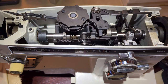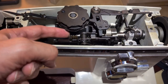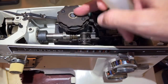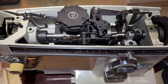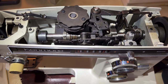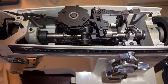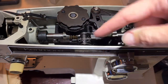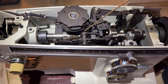Don't add six or eight drops because you're going to flood the machine and end up with a really bad oily mess. Now you're going to see some grooves down here - that's a gear that rubs against another metal gear underneath. This cam stack has grease on it, not oil. Some machines will call for oil, but I use grease on these. Your manual is going to have lots of arrows pointing to where to oil - start with the manual.